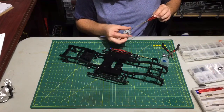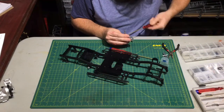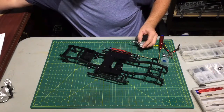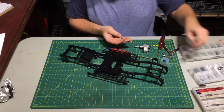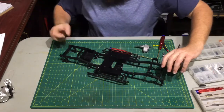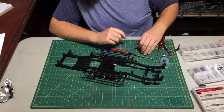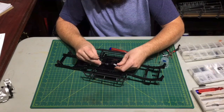Okay, there we go. Make sure you pay attention to which side threads. One side's got threads, one doesn't. Next, we will slip it in and the bearing into the bearing carrier. That's the bearing, small, sealed. Okay, so that actually goes, we'll flip the truck over. That's a lot more stable, and the bearing goes in the carrier on the back side, which to me makes, oh yeah, that makes sense. Looking at it now, put the transfer case with the shaft.